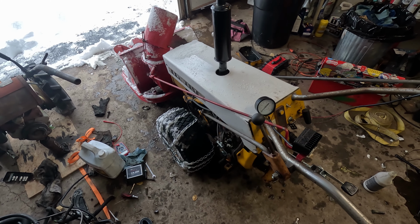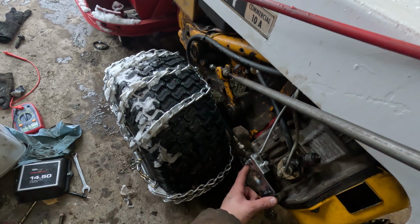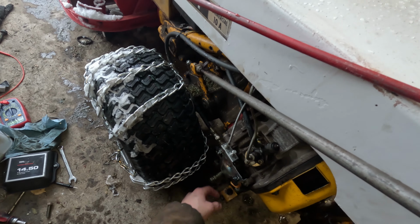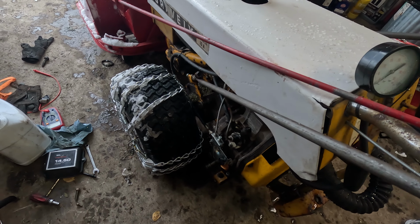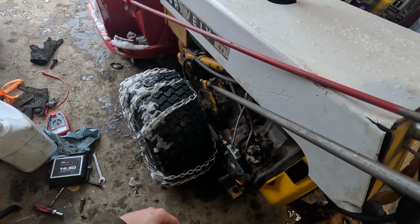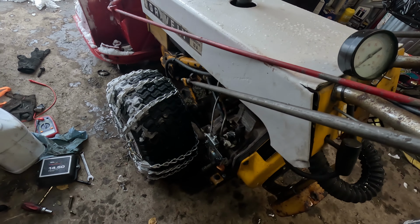Okay, I hauled it inside and I did a little tinkering. I think I know what was up. So I adjusted the governor springs and I turned out the fuel screw a little bit more so we'll get more fuel. And let's see how that does it. I think the problem was that the governor wanted more fuel, but the screw was limiting it. Let's give her a shot.